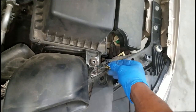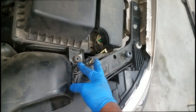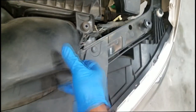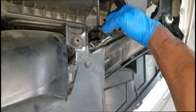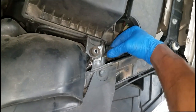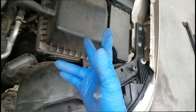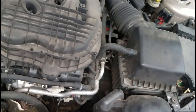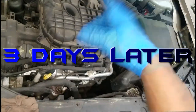All the harness wires are open because something has been chewing on this. I can't see anybody physically doing this. Actually, if this wire was routed the way it's supposed to be, I can't imagine that wire being on top of there - how did it even get up there? That's either a sabotage job or squirrels. So I've gotta write up an estimate on wire repair. You do not have to do the whole harness - you just have to cut and splice the open wires back together. Wow, I haven't seen anything like that in a long time.